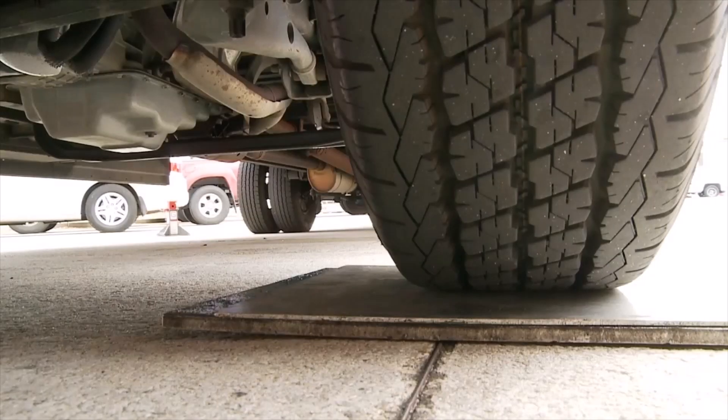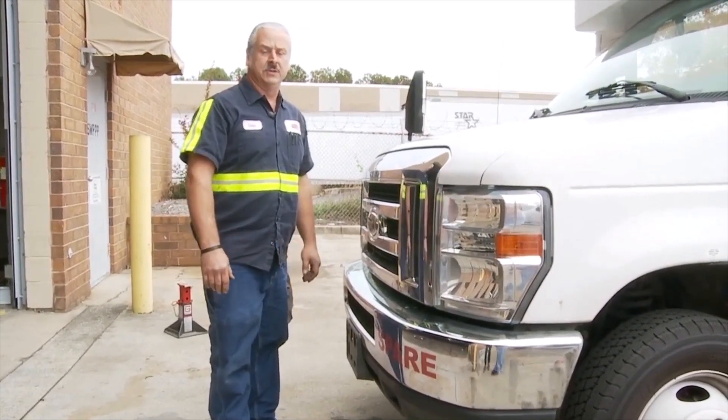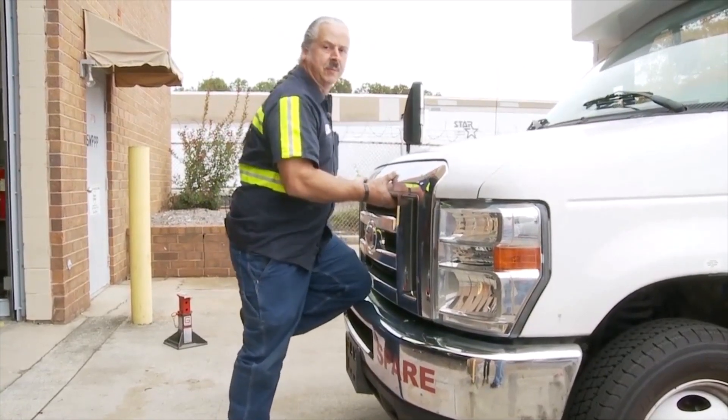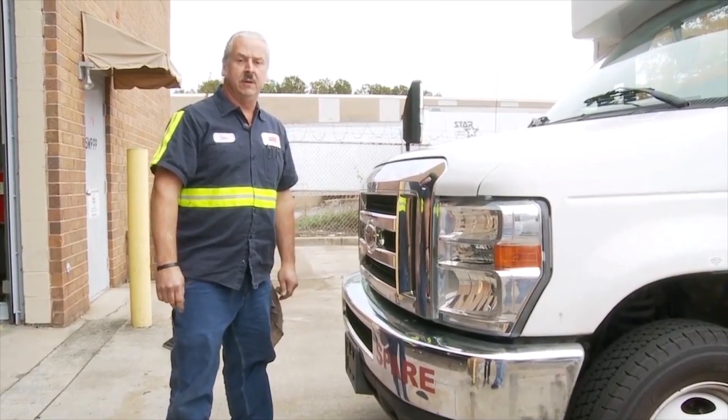You can see how much the plates moved to put the vehicle suspension at rest. They are necessary for doing alignment because if you did it on a hard surface, the friction between the tire and the concrete wouldn't let you get an accurate adjustment. To make sure that your suspension is at rest once you've got the wheels on the turn plates, bounce on the bumper a little bit. And we should be ready to set our equipment up and do an alignment.